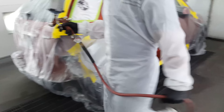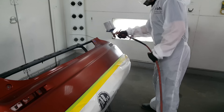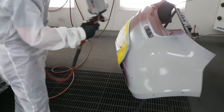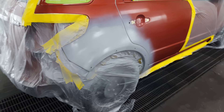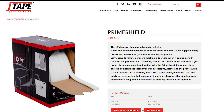What you often run into with door jamb areas where the door and quarter line up is that you can put this color down and sometimes it'll travel further into the jams than you can cover in your next coat. What we've done here is applied a second piece of foam tape on that edge, then remove it after this dries, to keep the color from traveling too far into the jam. Most painters would be familiar with that problem — it's more common with sealers, which seem to travel a lot further than base coat. There's actually a product I've seen at SEMA, I believe made by J Tape — a two-piece foam tape you can peel off in the same way but it's a bit more practical.